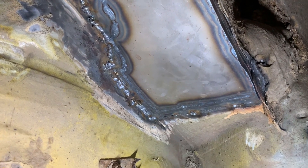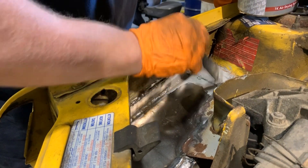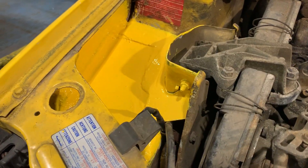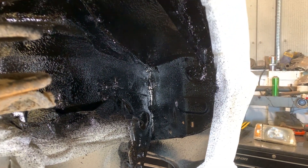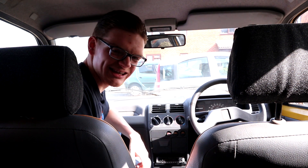With the plating done, the welds are protected with seam sealer before the top is given a coat of yellow paint, the bottom undersealed, and the Peugeot's rust repair is done. Farming the job out to someone else isn't really in keeping with our DIY theme, but the rust repair was done really nicely, and now it's painted and rust protected it should stay solid for the future — and because I didn't do it, the car is still here.